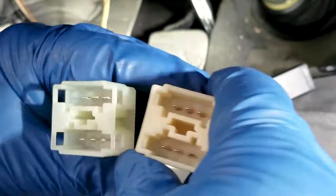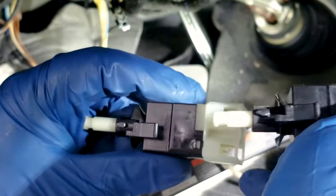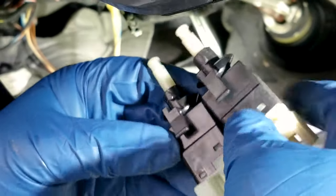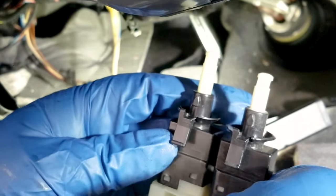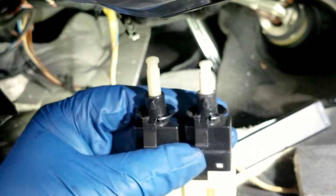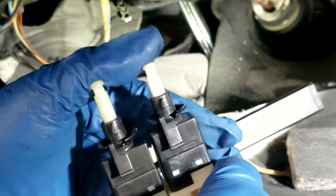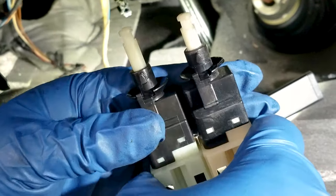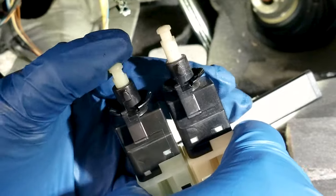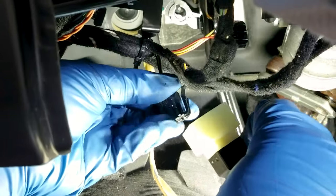Here's the new one on the left and the old one on the right. I did notice that the old one is a little shorter. When installed with the brake pedal not operated, it will be in the depressed position — and you can see the old one is a little shorter, meaning the spring mechanism inside is no longer as good.